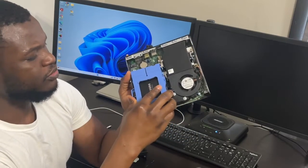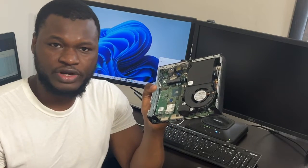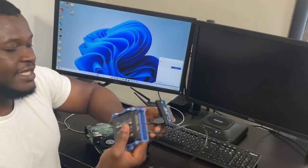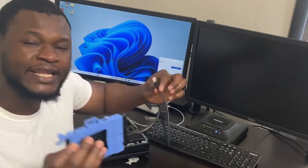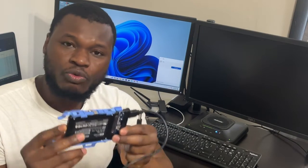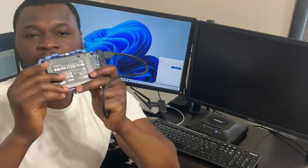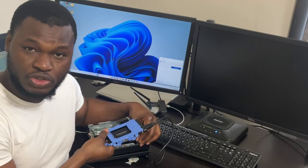For the person who has a virus making it harder to perform recovery, I'm suggesting to open up the PC, take out the hard drive, and use an external hard drive connector — an SSD connector. You connect it to the drive and connect it to the PC, and it becomes like an external drive. You can then scan the disk with your antivirus to remove the virus, copy the files you need to another drive, format this drive, reconnect it to your PC, and perform a fresh installation.